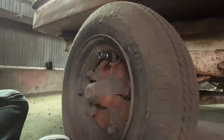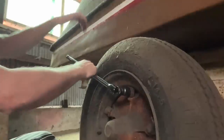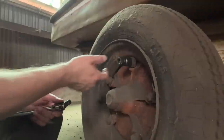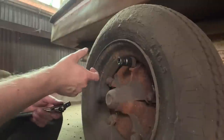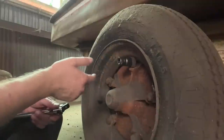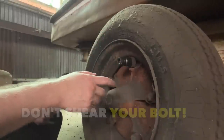Now I'll back it out, make sure I'm still attached at a good 90-degree angle, bring the arm up a little higher and do it again. Pretty simple percussive force with my hand and I'm getting a really good rotation — it's already loosening up. If the metal seems seriously fatigued, you can pull the bit off and put on a normal ratchet, rotating in a tightening direction to help break up rust and scale if the bolt is in danger of breaking.